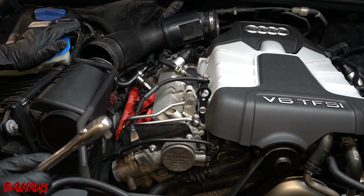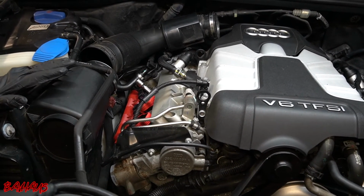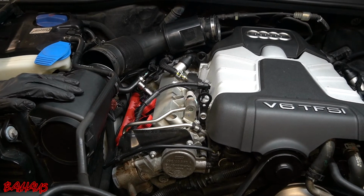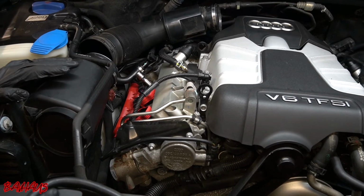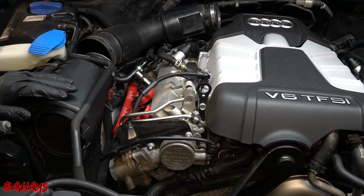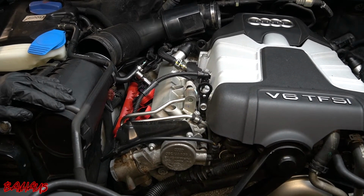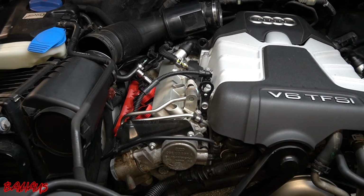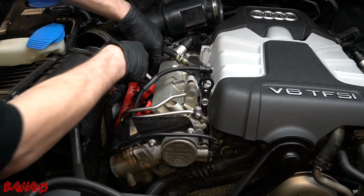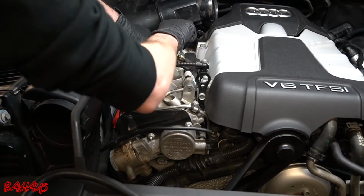And the most valuable thing that I think we gathered is that I don't believe that there's a valve train issue. So not only from driving the car, but even the numbers were still up, you know, in a good range. So honestly, what I'm gonna do next is go after that cylinder 2 fuel injector. So I'm gonna reassemble what we got going on here, and we're gonna leave everything alone.